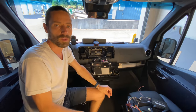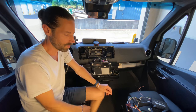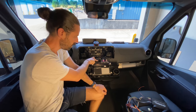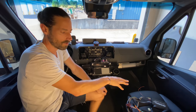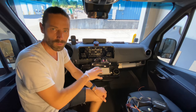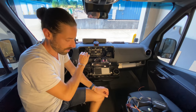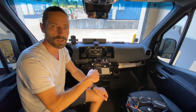I'll put a photo at the end of the video so you can lay it all out on the floor, pre-wired. Once you've got all the harnesses connected, plug them into your head unit and run them to wherever you want to mount your amplifier, then run the very long extension out to wherever you want to put the subwoofer. You can route that right under the factory floor — there are pre-built wire chases. Just pop off the plastic panel, chase your wires, and put it in any location you want. I'll put a link in the comments on how to order the product.